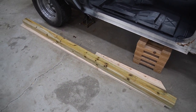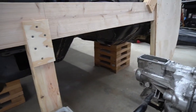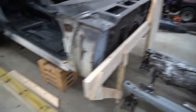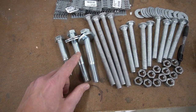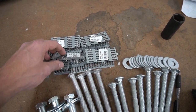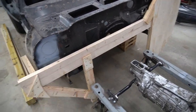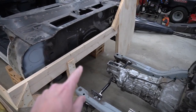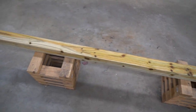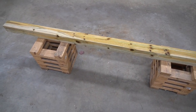It's another day. Picked up a 4x4 post — I feel better with that than two 2x4s screwed together. Basically, we're going to use that to go from body mount to body mount underneath, then come out and up to attach to the front jig piece. Also picked up longer body mount bolts — these are 5/8-11, 5 inches, so we'll get through the 4x4 post easily. Got some more steel mending plates as well. We need this to be 47 inches long and the bolts are 42 inches on center.